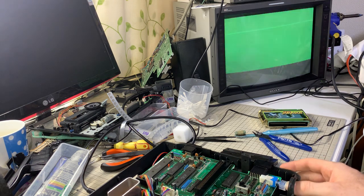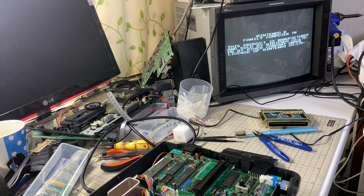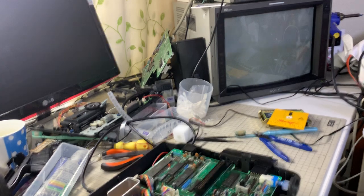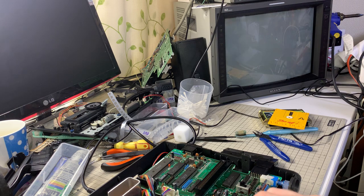Let's do it again. 1, 2, 3, 4, 5, 6, 7, 8, 9. Oh, yeah, about 8.5 seconds. So, can I improve that? Probably can. So I'm just going to adjust it slightly. Some people would leave it there, but some discs while it reads that disc, it might not read another disc because they can do that. So to get it reading as quickly as possible means that it's as finely tuned as it can be.